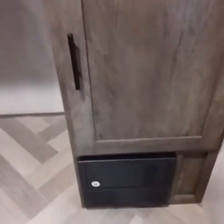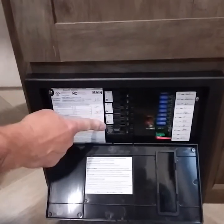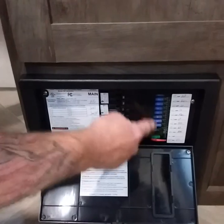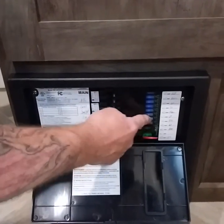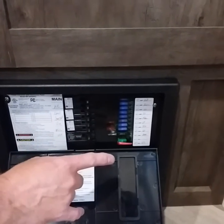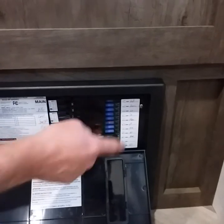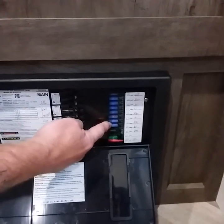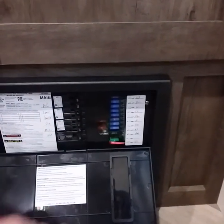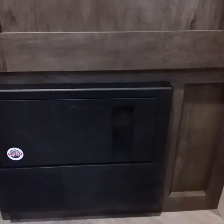This is where your power box is located in this trailer. Inside you have your 110-volt side and your 12-volt fuse side. Carry some extra 15-amp fuses — if a fuse blows, a little red light on that side will indicate which one it is. Remove the blown fuse, put a new one in, the light goes out, and you're back to camping.